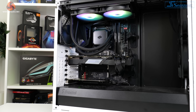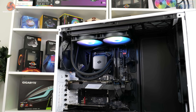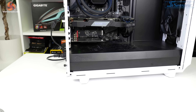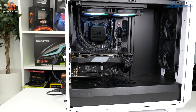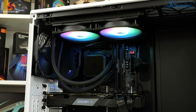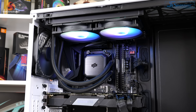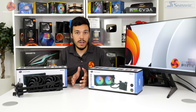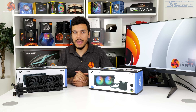The GPU is an RTX 2060 Super with its zero decibel mode, which we don't interfere with for fan usage on the liquid cooler. Clean power comes from a Seasonic Titanium-rated TX1000 one kilowatt power supply, and our chassis is a Fractal Design Meshify 2 with three 140mm fans — two as intake and one as exhaust. For testing we use a 30-minute looped run of Cinebench R23 NT and record the steady state CPU temperature towards the end of that run. Ambient is maintained around 22 to 24 degrees Celsius, with additional test runs if it deviates outside that window to ensure data validity.